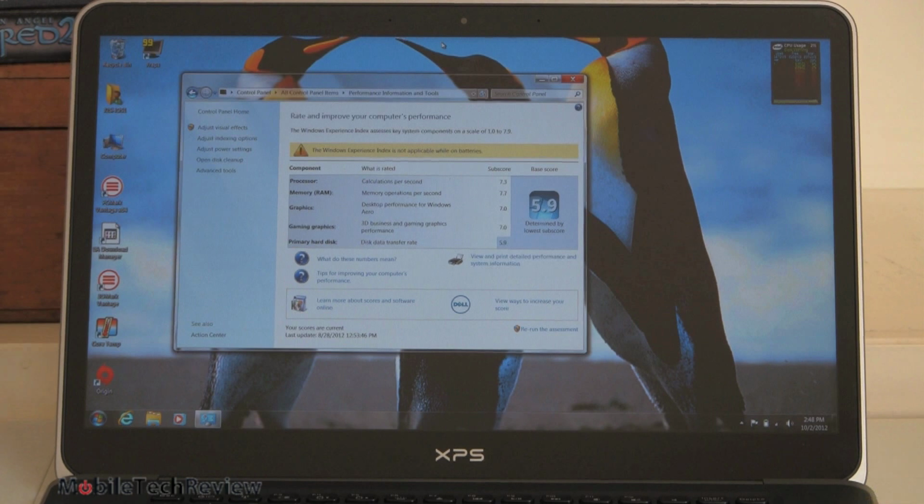So when Dell first came out with the new XPS 15, there were problems with it doing a lot of thermal throttling. Anytime the CPU hit 80, and obviously it's pretty easy to reach 80 degrees, it would start throttling back the CPU down to 1.2 gigahertz, not making gamers very happy. So now we're up to BIOS A09. There have been quite a few BIOSes that have passed by since this machine originally came out in late summer of this year. And what they've done is raise the thermal ceiling for the CPU, but now they've dropped it on the graphics processing unit, the GPU. What does that do? It means if you're playing games, you're not going to have a good time with it even still.